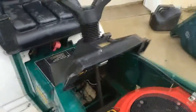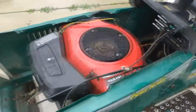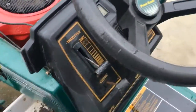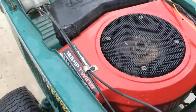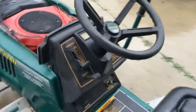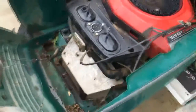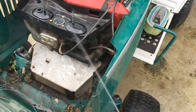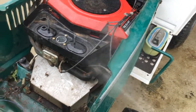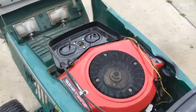Obviously, because the gas tank is not connected, I'm not able to run it with a proper fuel supply. But I was able to start it and get it to run off of some starting fluid. We'll see how the battery is right now, see if it'll turn on its own. Battery's a bit pooped. So I'll have to grab the start cart and wheel it over here and hook it up. So I got the battery charger hooked up. I'll go ahead and spray some starting fluid into the carb here. This can's almost empty, so I've got to do it from an angle. It's probably a little more than it needs, but oh well. I'll give it a full choke, about three-quarter throttle. There's the key.